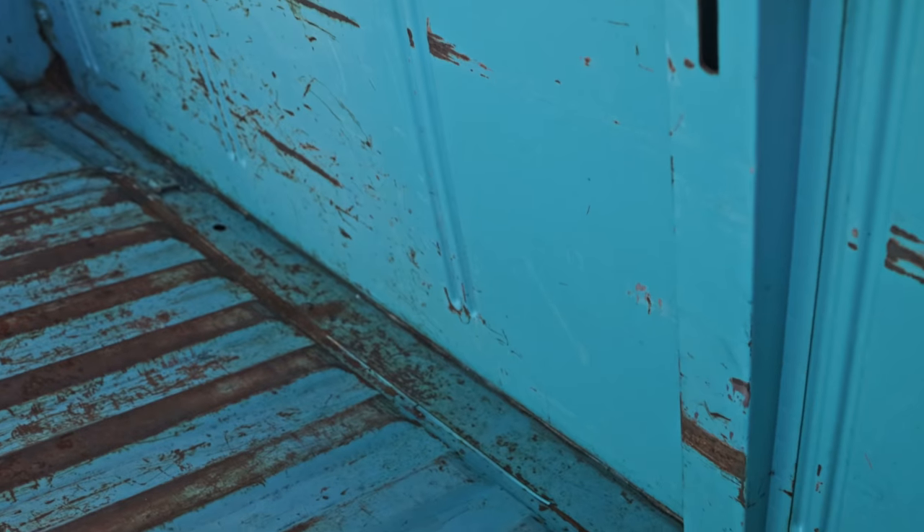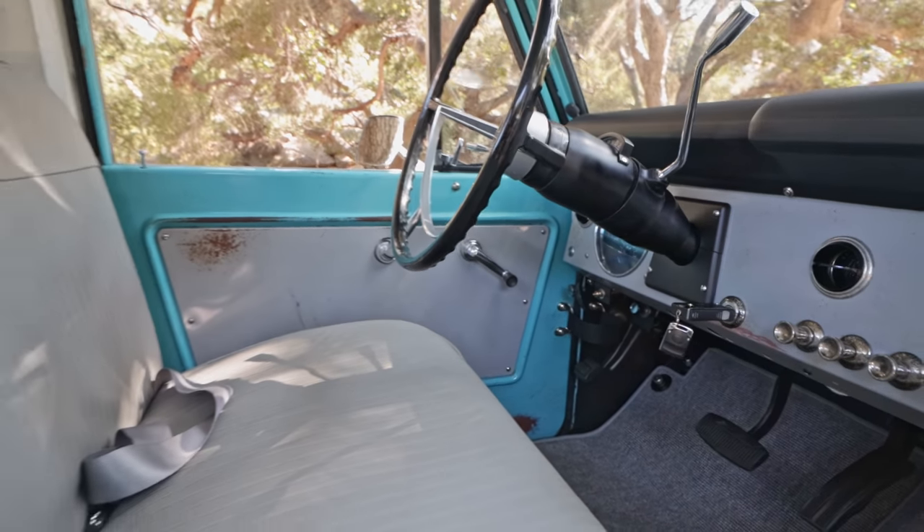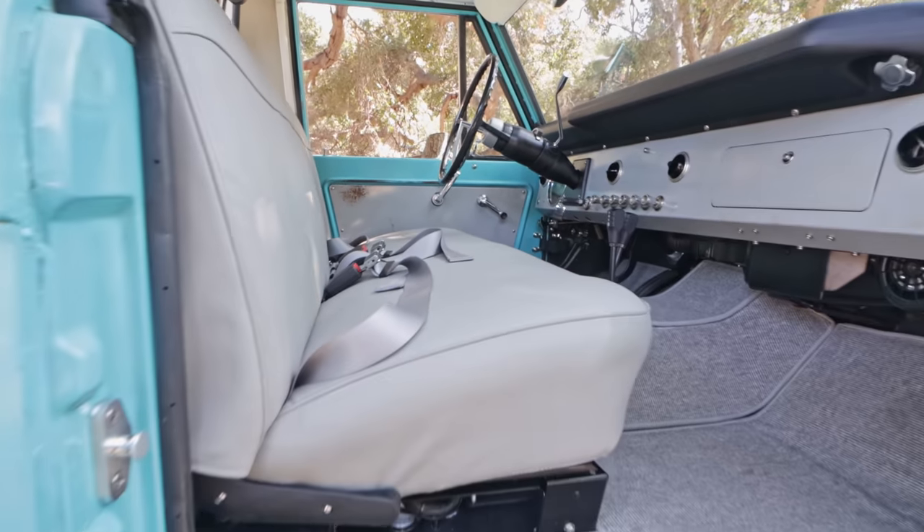In the bed of this truck you'll notice we did not do the usual polyurea coating — the client wanted to keep more originality and patina present. We did sneak in the FJ40 sun visors because the stock ones just suck — you have this big monstrous plastic thing in the middle and you really feel caged. We also ran more contemporary but classic-style lap belts. The client did not want three-point belts, and with the U14 there's really nowhere to properly mount that third pivot point anyway.